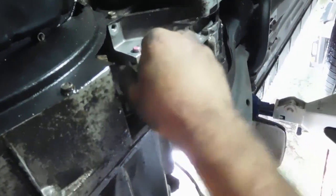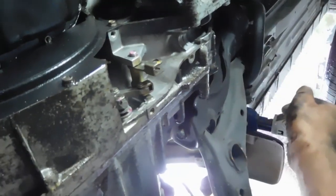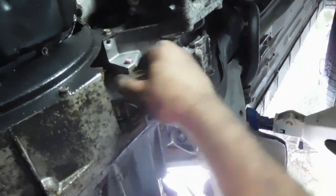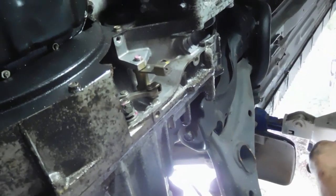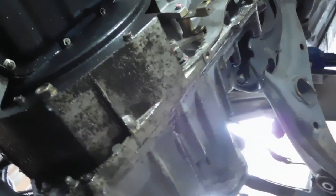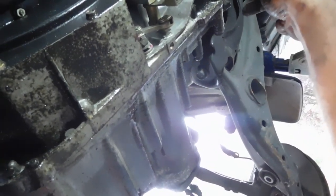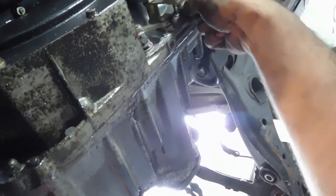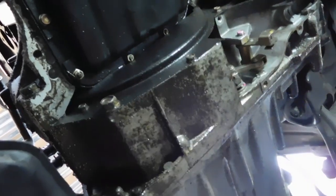But, you know, this is what happens when you pull on that cable inside the car, or just park or whatever. A couple gears, whatever. It doesn't matter, because I'm pulling this transmission. Okay, next thing, you want to take care of stuff underneath the car so the last bolt is above the car. I hate getting underneath the car when it's the last bolt because then it could just fall on you. So we're going to undo these here: 1, 2, 3, 4. And we're going to do the flex plate bolts in there.